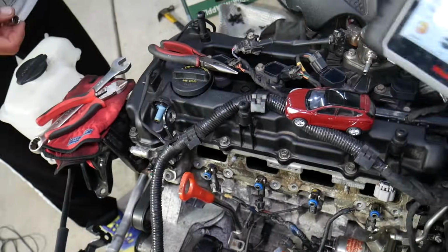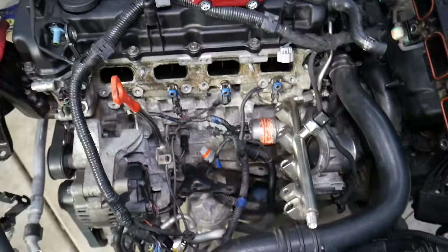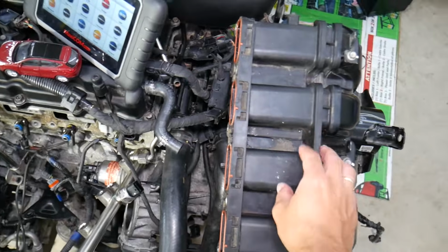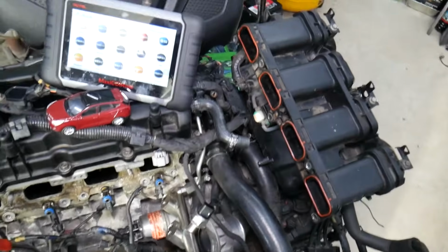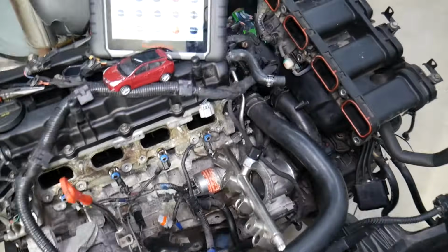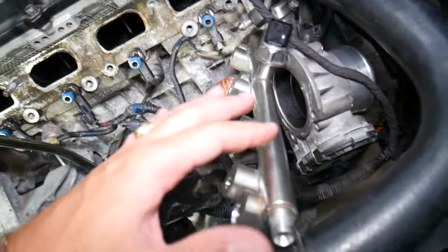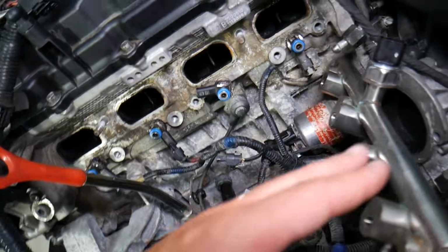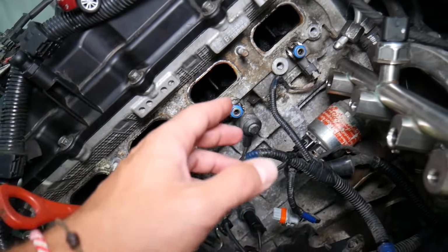So, the things that we have removed in order to get to the knock sensor. The only thing that you need to remove is the intake manifold. That's your intake manifold, and if you want to see the complete video on how to remove the intake manifold on a Hyundai Tucson, it's on our channel. Once you remove the intake manifold, you don't need to do anything to the fuel rail or the fuel injectors, but we removed it so we can clearly show you. You can do it without removing it.